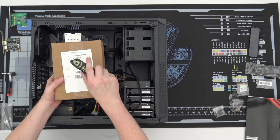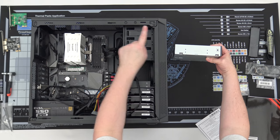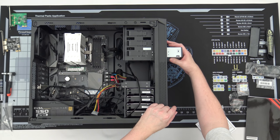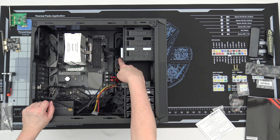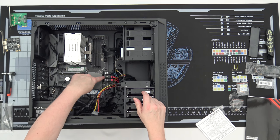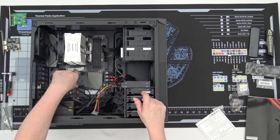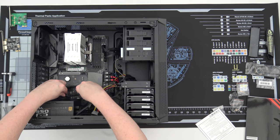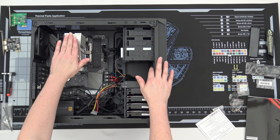With the back panel reinstalled you can see there's no mess whatsoever — perfect cable management every time, or at least you're just never going to see it. It is now time to install the 14x Blu-ray drive. I was originally going to install it on the top bay but the cable doesn't quite reach, so it's going right here. The Blu-ray drive is now installed — power and data are running to it. SATA port one is not being used; the other five are being used.